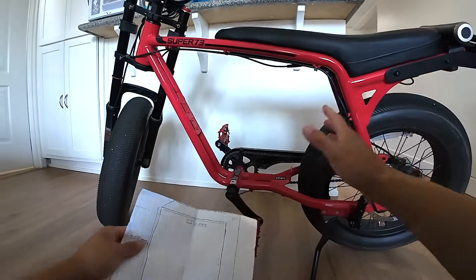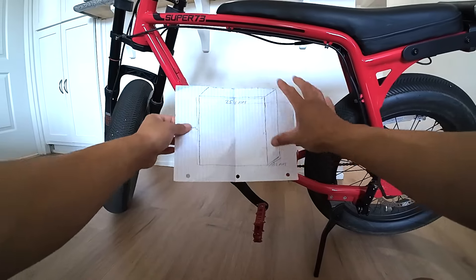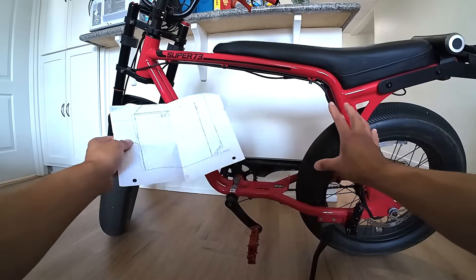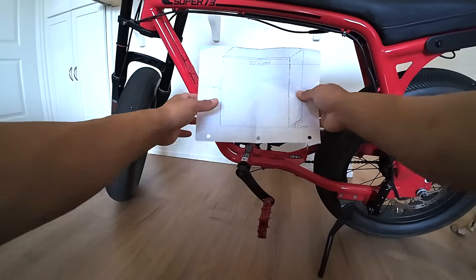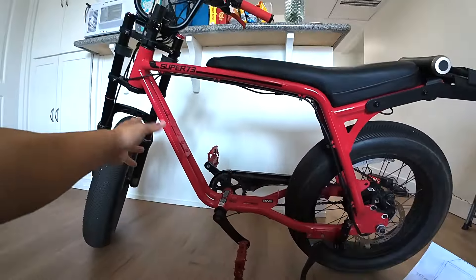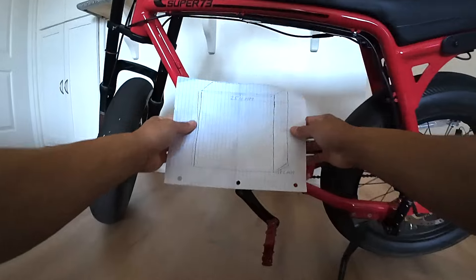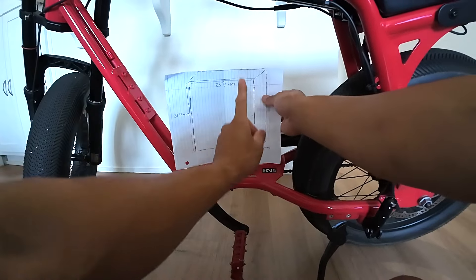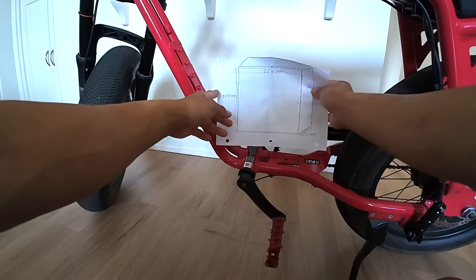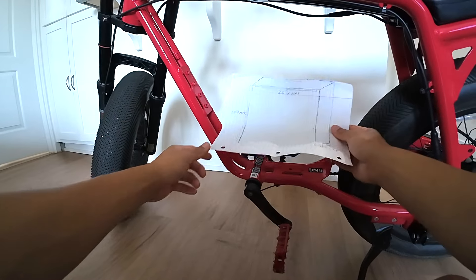Now that we have our dropouts measured, let's move on to battery placement. Originally I wanted to go with a giant cube so that if I ever wanted to take the battery out of this bike it could easily go into a bike with a different frame because the cube is kind of universal. But I realized it would be kind of hard to strap down a cube to this frame because we're working with some angles — this is like a parallelogram or diamond shape frame. If I used a cube I could strap it down vertically, but I'd also need something horizontal and it would be at an awkward angle because it doesn't flow with the shape of the bike. So I made another cutout.